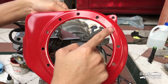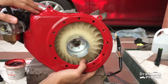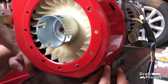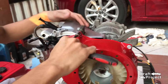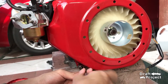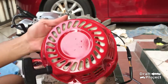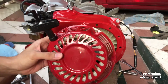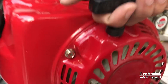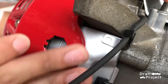The recoil starter has only 3 mountings. Insert the flywheel cover and tighten the bolts. Try to test it and see if it works — and yes it does. Put back the little rubber grill mat.